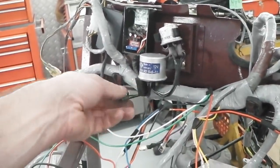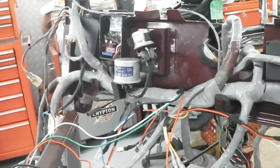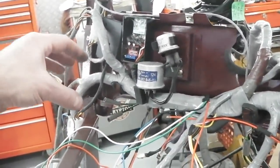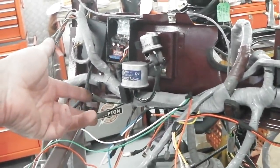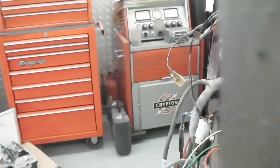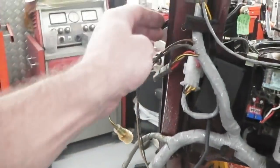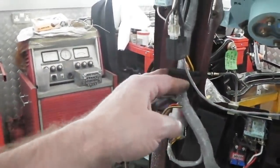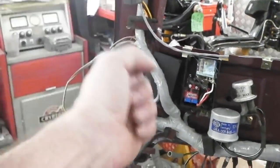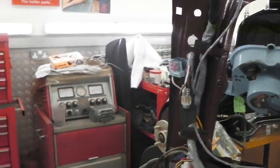They're already there. So when the factory read the option and it was ordered as a GXL car or an XL with hazard lights, the hazard loom would be separate and it would plug into this, and there's a red power connector somewhere too for it to pick its power up. I don't know where that is. It's in the factory loom somewhere, going up, a little red connector, and the factory assembly would then plug that hazard loom in, it would come with its own switch, and you'd have hazard lights.